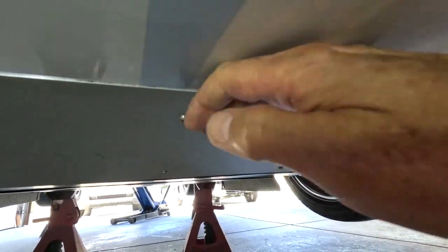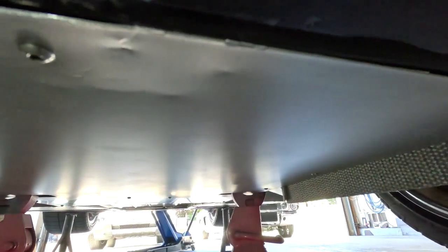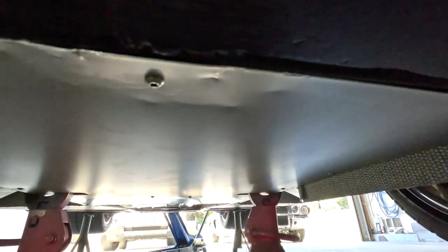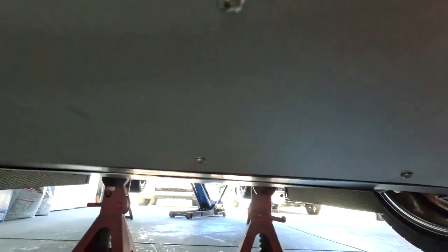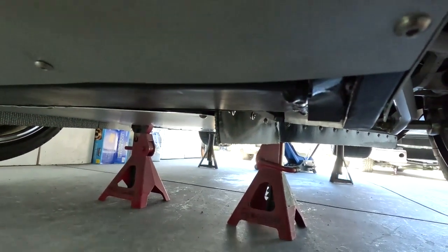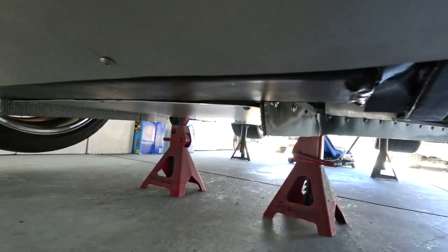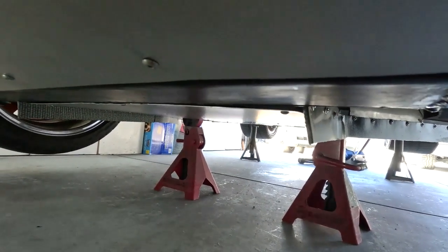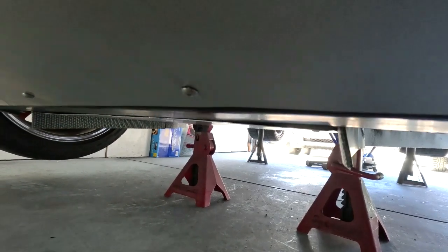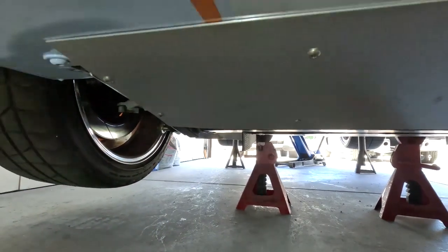The panel has a few degrees of angle so air gets driven underneath, and I've also flat-bottomed the car all the way back to the oil pan — probably four to five feet. There's also a conveyor belt skirt about an inch and a half deep; it was three inches but it was rubbing everywhere when driving. That skirt keeps the high pressure and low pressure separated to some extent. This is about the best you can do according to our SolidWorks model.